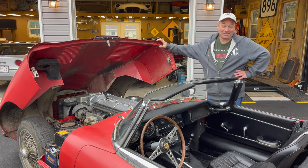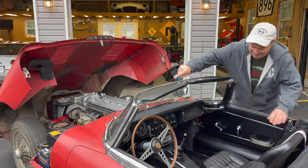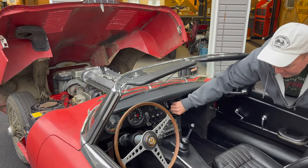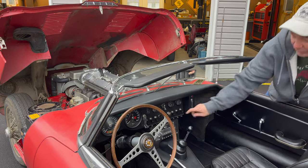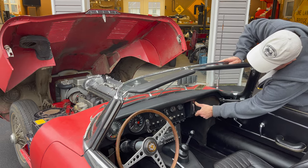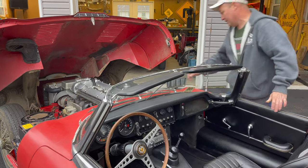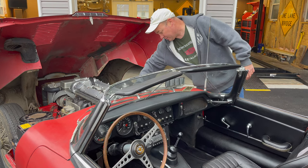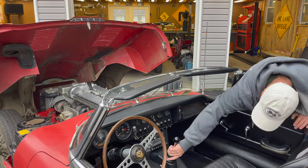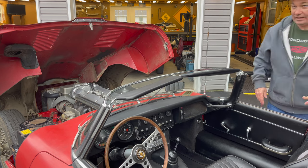Okay, this is it. Very nervous, but let's give her hell. I'm going to reach over, turn that ignition on, turn this one on. Fuel pump's not doing anything because we're already pressurized. I'm going to go ahead and choke it, which is what I would do on any other E-Type. Make sure we're in neutral. Choke's in. Okay, here goes.